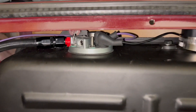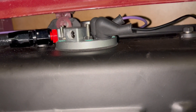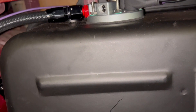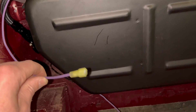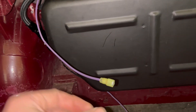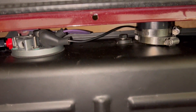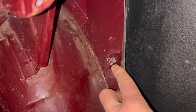Fuel tank is installed and the fuel line is run. There's decent clearance on top — that's the fuel pump. These are the wire connections with the little boots on them. I used a purple wire for the power wire, which also ran through the passenger compartment, and I put some quick disconnects on them in case you ever have to pull this tank out or service it — that way you can just disconnect it and pull it out without cutting your line. For the negative, I'm just going to run it over to the back and hook it up there.